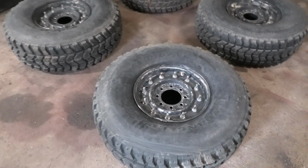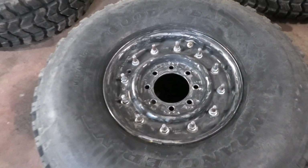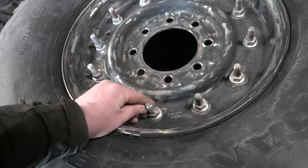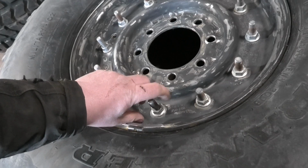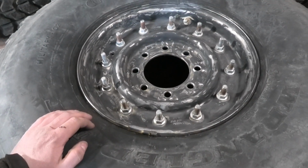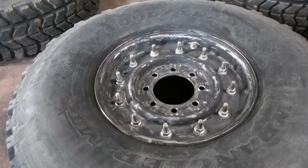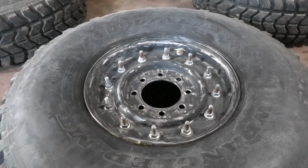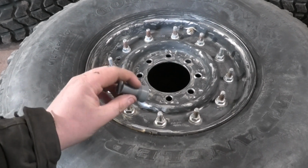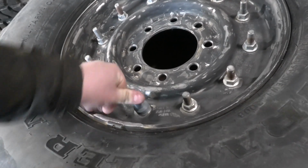Alright, so this should be plenty good for some fresh paint to be able to stick to those. Now I just have to go in and cover up all the things that I don't want to paint, like all the bolts, because you don't really want to fill these threads with paint. But really, I'd already started crying just at the thought of having to manually tape every single one of those. But then I remembered I have a 3D printer and figured maybe I could do something clever with that. So I just quickly modeled out and printed a little cover like this to go on there like that.